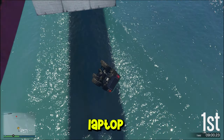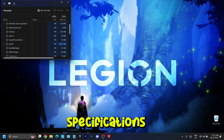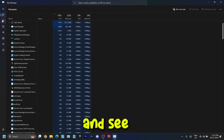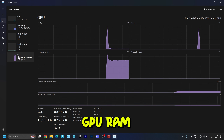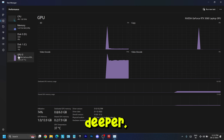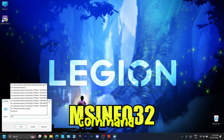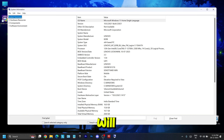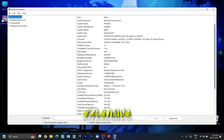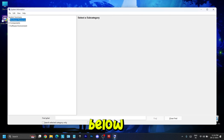Next, check the specifications of the laptop thoroughly because you may have been scammed by being given a lower spec laptop after being promised a higher one. We can check general specifications by opening the Task Manager and seeing the CPU, GPU, RAM, hard drive or SSD, Wi-Fi and Bluetooth version. If you need to dig in deeper, it can be done using CPU-Z or by running a command in the Run dialog box, which will tell you the smallest details of your particular laptop. If you want a special video explaining all this, comment down below.